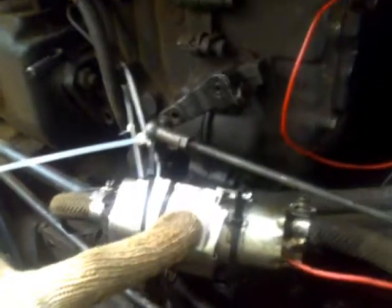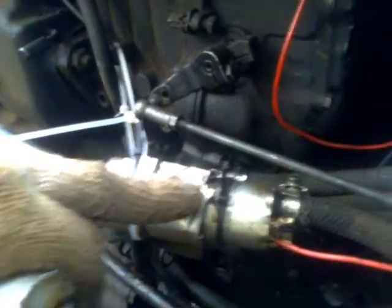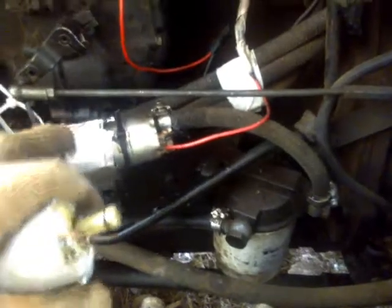By the way, this pump is, despite its bad appearance, newer than that one. That one I have is the first one I installed, which worked very fine from 2015 until 2020, but then it got clogged, as I had it installed right before the fuel filter. So I removed it, took it out for cleaning, and I installed this. This one is from Aero, one of those Chinese junk that we have all around. It works fine despite being Chinese, but as I had this little accident a little time ago and it damaged everything, while I am repairing this, I reinstalled the previous one and it works fine.